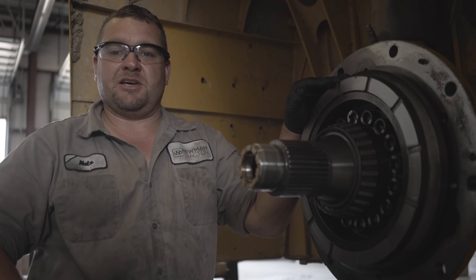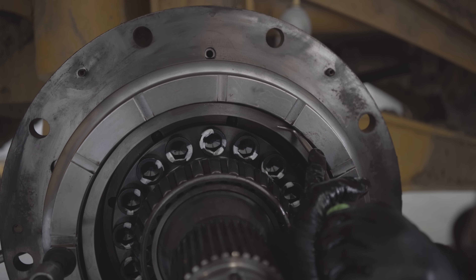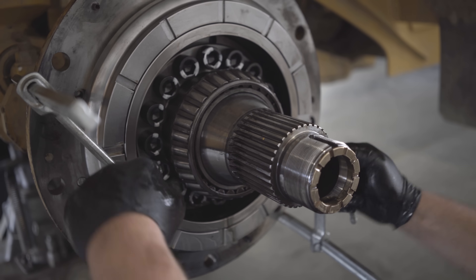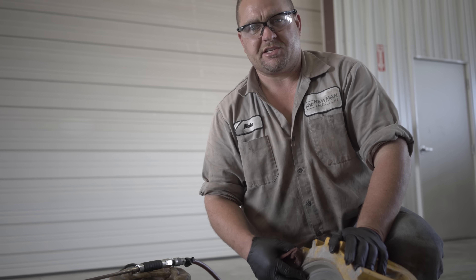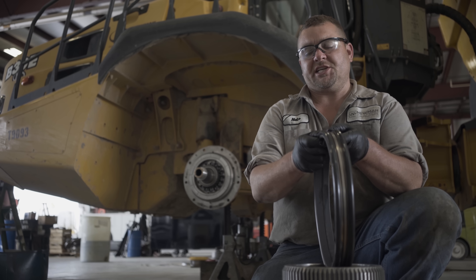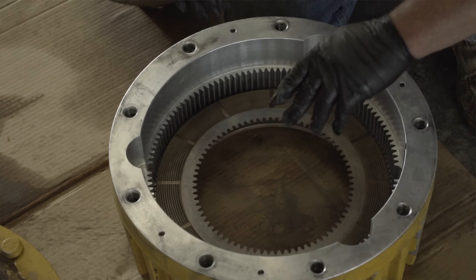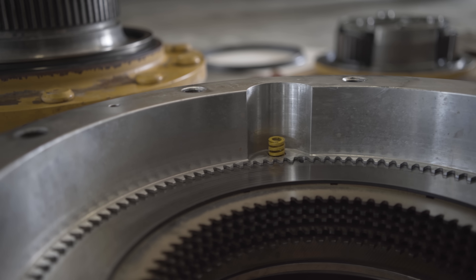It's time to start the assembly process. Apply light pressure, and then I will start the seal with the blunt end of this O-ring pick. If it goes on easy, then you know you've done it right — just like downtown. The seal that goes onto here is an O-ring seal. If there's any kind of crud under that, it's not going to seal right and you're going to have a leak. What actually seals the oil is the machine surfaces of these two seals. We'll have to alternate the friction discs and the friction plates. The return springs are going to take the pressure back off of the pressure plate when you release the brake pedal.